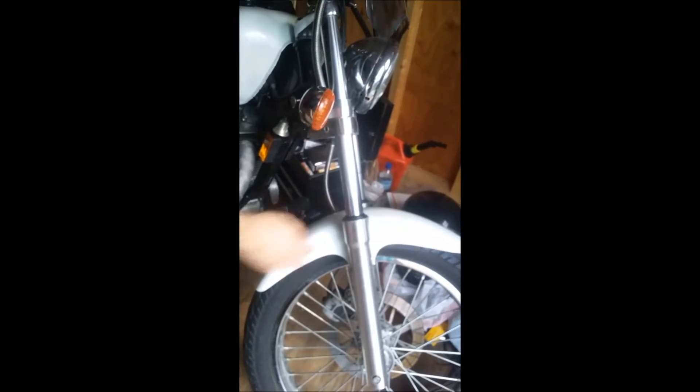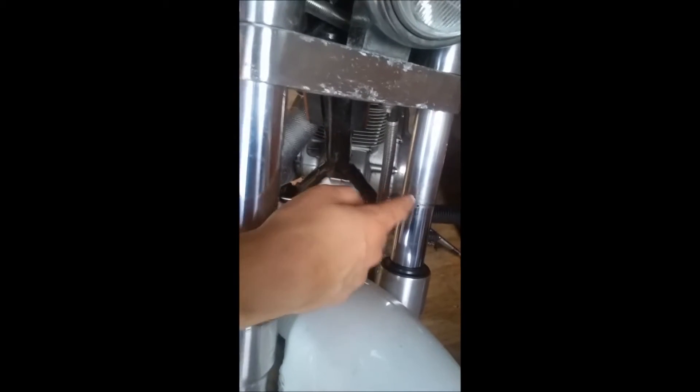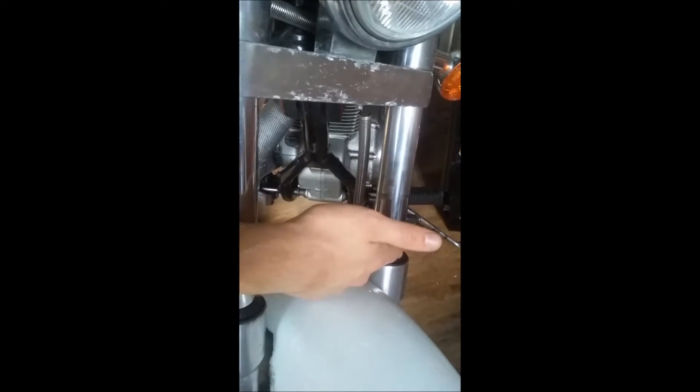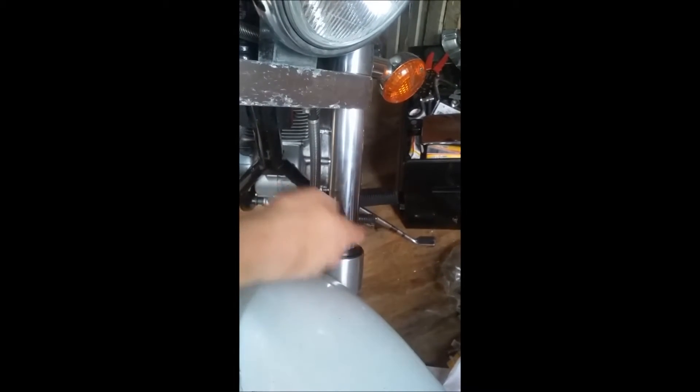Now, if we look at this bike — this is the 2000 Suzuki Savage we were going to look at before — if you zoom in here, you can look and already we can see on the left side we have a grease ring around here. All you really got to do, if they're bad, is just run your finger up once. And if you feel any kind of oily residue, or you got dirt and grime and grease coming up, your fork seal's bad.